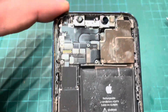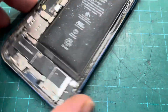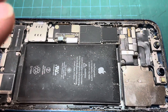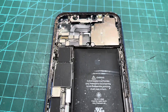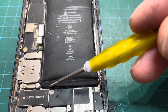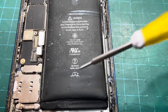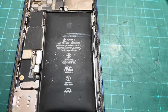Screen's taken off. We're now going to remove that tab, that tab, this tab, this tab, and this tab, and then we're going to take the battery out. I'm going to fit the new battery first to make sure that the battery is fully working before we even start the whole job. Just put a little bit of alcohol on the top and the bottom, so I've got this tab to come off here and this little tab and that tab to come off there. I find the alcohol helps a little bit and I've wiped off some of the battery information there by accident.